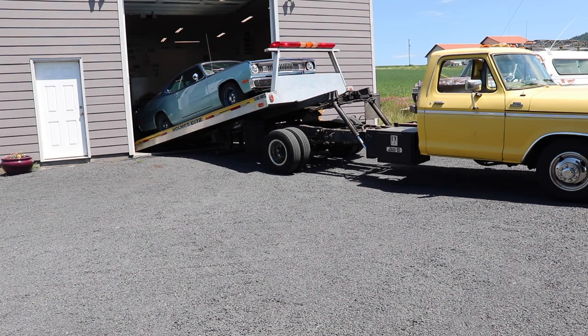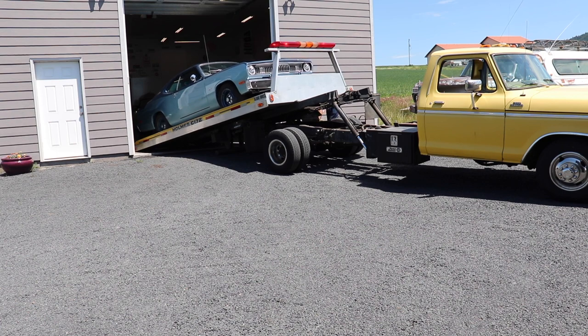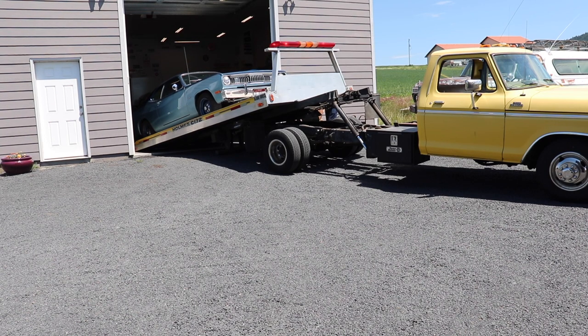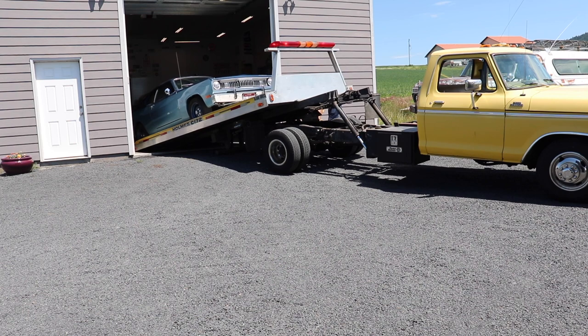There are a couple reasons I know this is an oil pump issue. First, at some point on the morning commute to work, I saw the oil pressure gauge was reading zero. I'm running an auto meter stepper motor type gauge, and it's fairly common that it fails to go through the boot sequence. I have two pressure sensors on the car — one for the ECU and the other for the auto meter gauge. I had the Haltech 2500 set to do engine protection on low oil pressure, but I never reset that option — I still had it set to trigger a check engine light, and unfortunately on the drive I did get a check engine light.